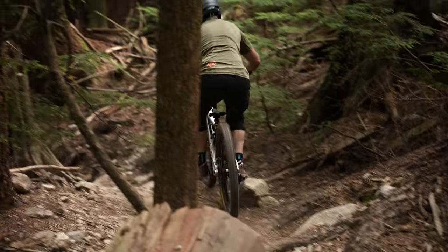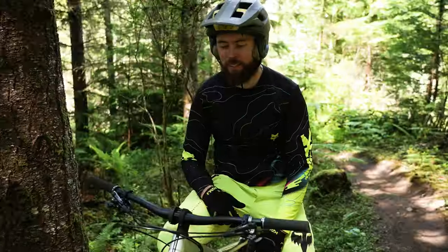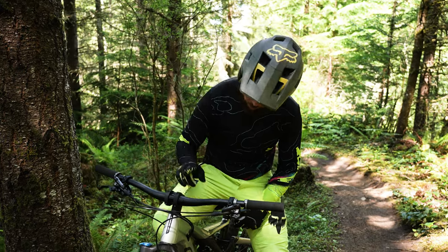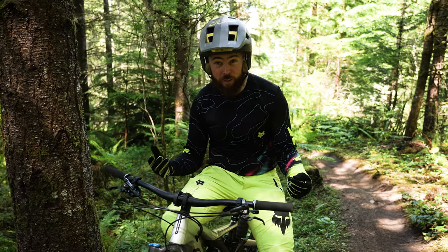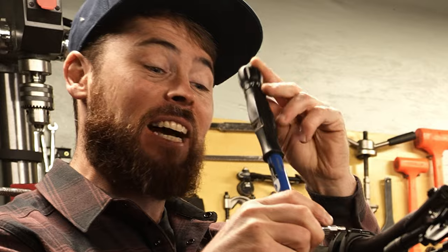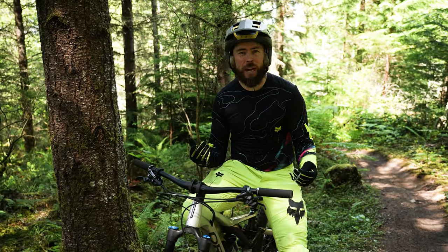I just tried to get fancy and do a little thing, my bike tipped over on the ground — this is like the second or third time this has happened. The handlebar slipped substantially on the stem. I followed the torque spec and did six newton meters when I clamped it with my Park Tool torque wrench — six newton meters, as tight as it should be and no tighter — but it keeps slipping. It even slipped while riding a little bit.